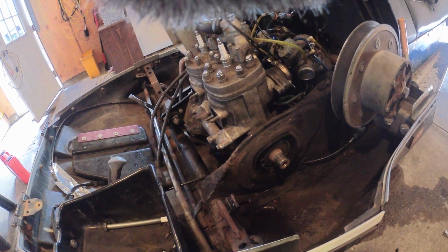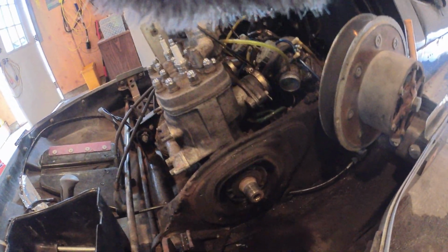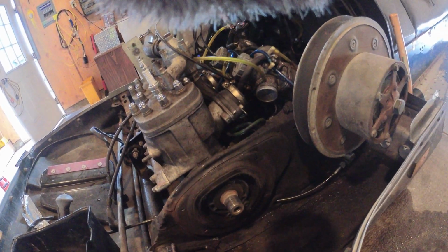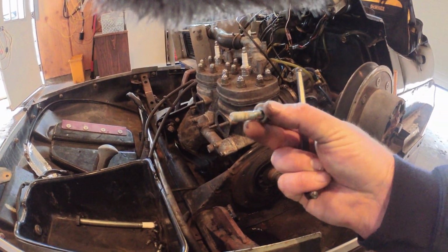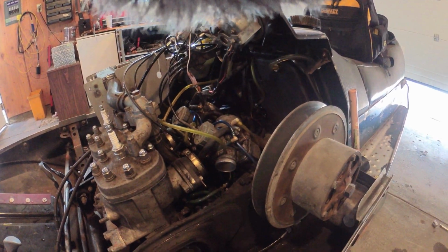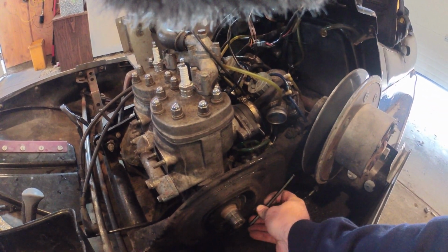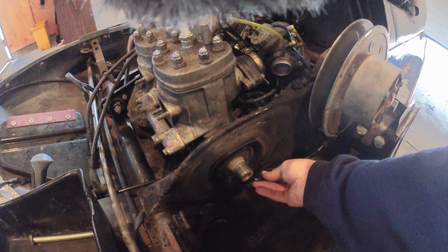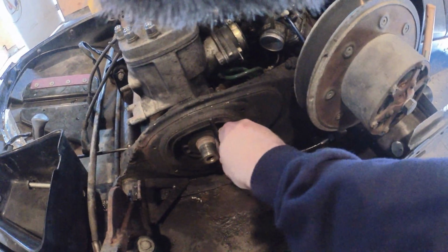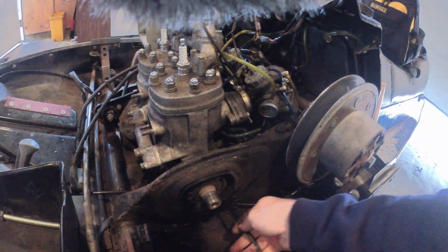So now that we got the clutch off, we got to go ahead and get this motor mount seal slash protector deal off of the side here so we can pull this thing through. I assume, anyways, maybe it doesn't need to come off, but I'm just gonna take it off there. It's got like 4 bolts that hold it on. They're kind of stubborn and really stuck on there. But we already got the carbs removed from the boots, and we'll start removing the radiator. Anyways, get these off of there and then update you guys in a bit.